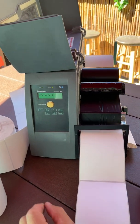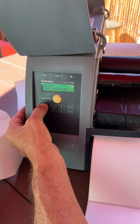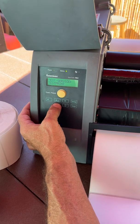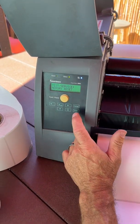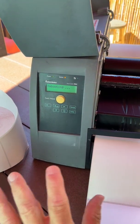The first thing you do is hit Setup, then left or right arrow — in this case we'll left arrow over to Test and Service, down arrow, right arrow to Memory Reset, hit Enter twice, then hit Setup and it'll reboot.